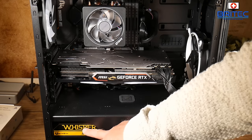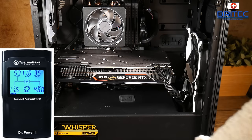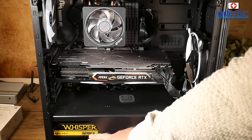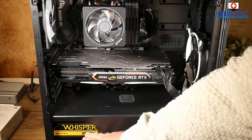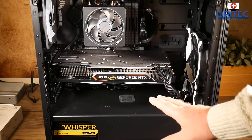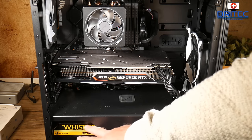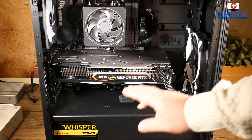For a quick reference you can try a brand new power supply, or you can use one of these little devices you can see on screen right now, which will help you determine whether the power supply is bad. It's not a 100% foolproof method, but it gives you an inkling that the power supply is delivering good clean power. It's a good starting point especially if you're not a PC repair tech and don't have spare power supplies lying around.